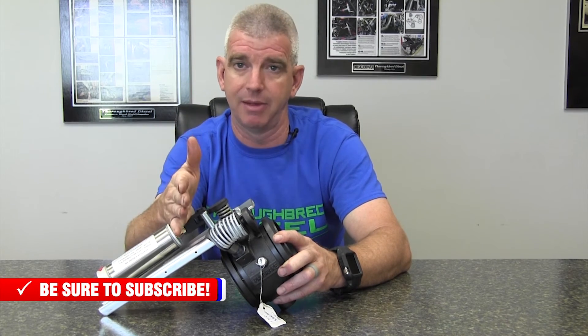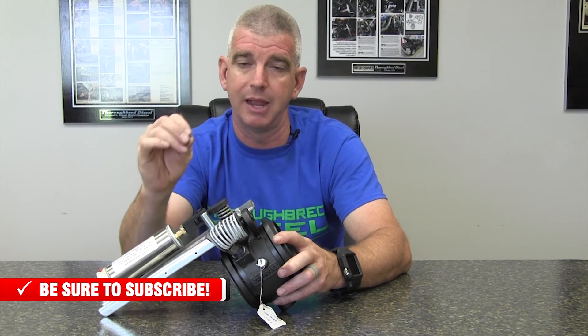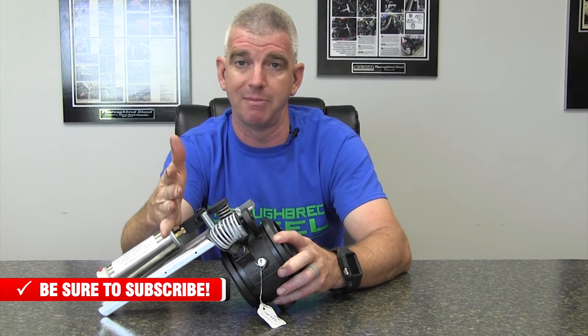Here are the high points: Chevrolet and Ford guys, all we offer for you are inline mounts, only up to four inch. Dodge guys, if you've got a 5.9, we've got direct mount or inline mount — you can do either one. If you've got a stock turbo, I suggest the direct mount. If you have an aftermarket turbo, I suggest the inline mount. The inline mount gives you the ability to still run an exhaust brake. Make sure you order the right mounting group based on your exhaust size. This is clear on our website — as long as you use the year, make, and model feature, it will drill you down to exactly the right brake for your truck.